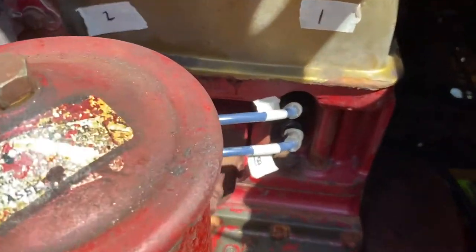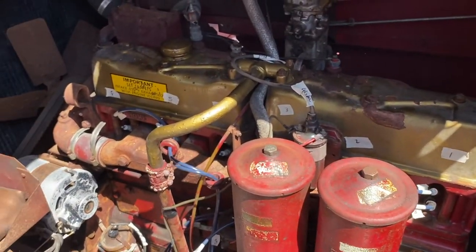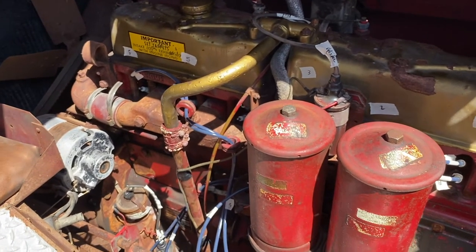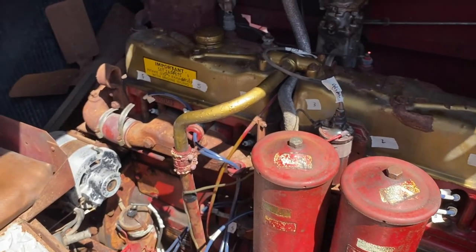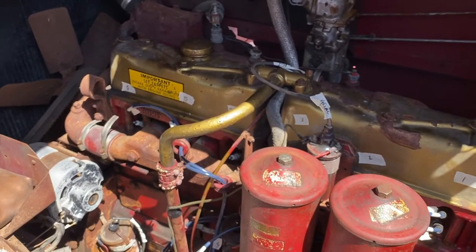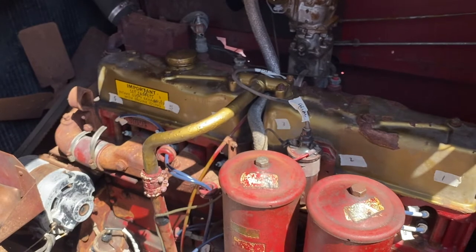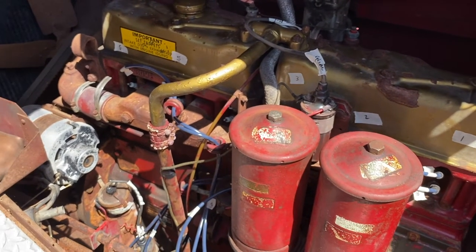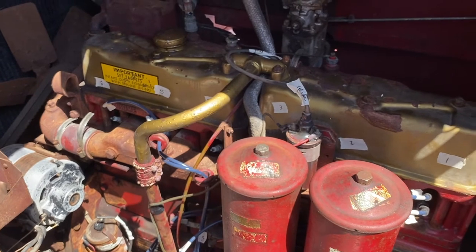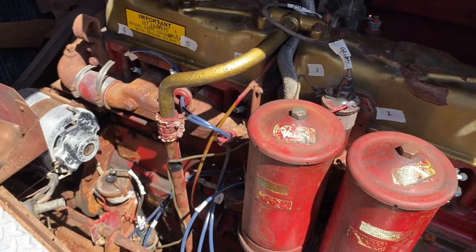I've decided to attach my wires with a label at the top and of course a label at the bottom. Then I want to cut them to size so that I don't accidentally cut them too short or have to pull them and struggle. So I'd rather do it in reverse, where I put on my spark plug wires and then cut them, and I can be very cautious when I cut. If I need to cut a little bit extra off or cut a couple times, I can always measure once and cut 2 or 3 times, which is such a luxury to have. Normally it's measure 2 or 3 times and cut once, and I can do it in reverse, which is a tremendous luxury. It really is. So I'm just gonna pop these last 3 on, finish labeling them.